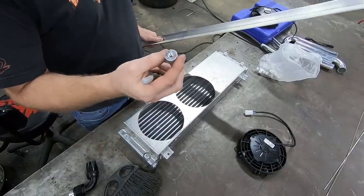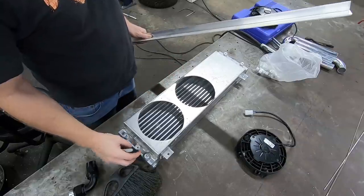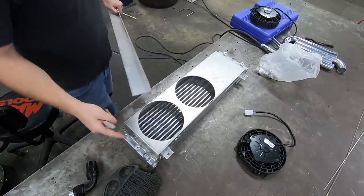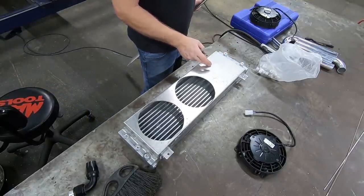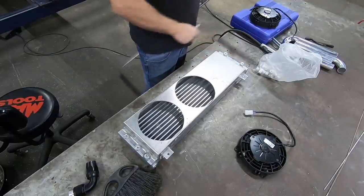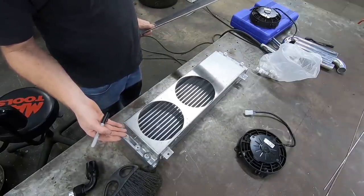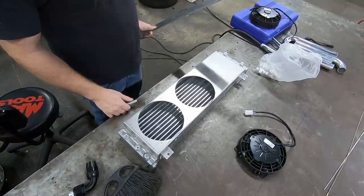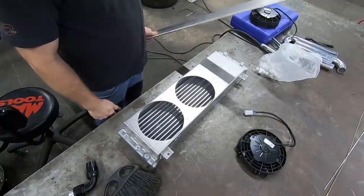I have these aluminum weld bungs set up for an eight by 1.25 bolt. I'm going to put those on the end tanks and weld them on. Then I'll use some strap on this end since this will be a perfect 90, and on this side I'll take some aluminum from the shroud cutoff, put a brake in it to match the angle, and build the mounting tabs. I'll get those all shaped out, weld them on, and have a complete fan shroud. Then we'll move on to our plumbing on the dual-pass side of the radiator.